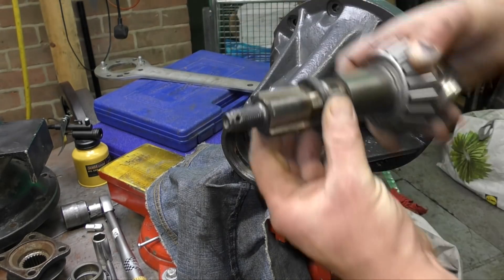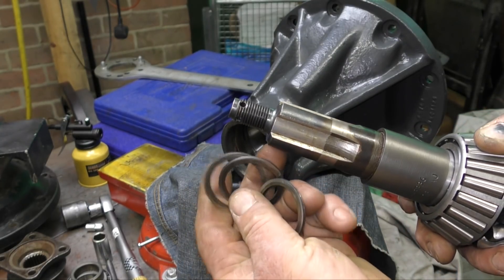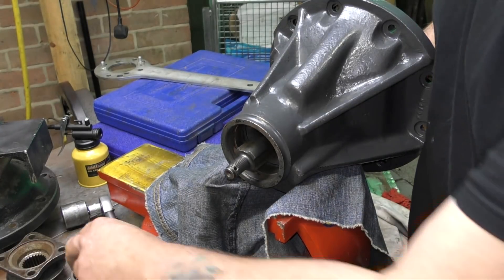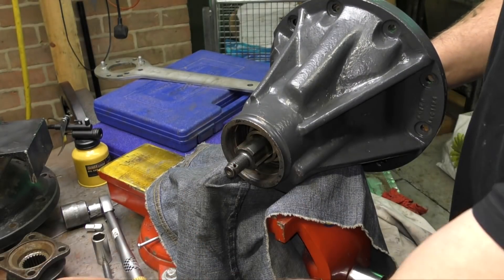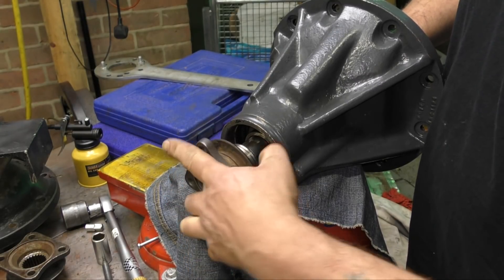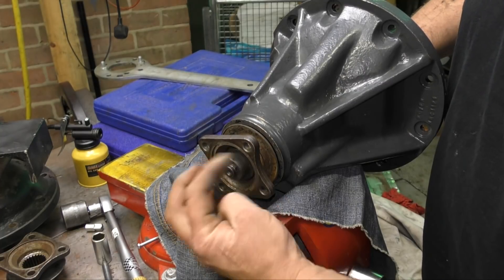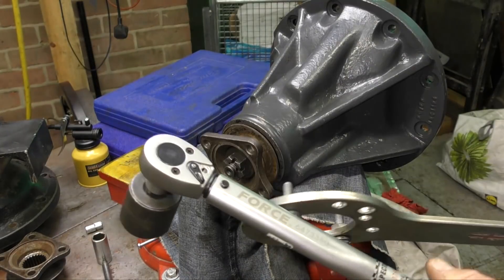The one that was extremely loose — I put three shims in. No good. So I'll put two in and then try it from there. I do have a discrepancy with the shims I've measured from these diffs and the ones that Land Rover recommends. There's a slight discrepancy. You can order the shims, and I expect you to order a few of them, not just one. There's no other way around this — unless somebody watching knows a way around it, it is a hit-and-miss affair until you get it right. It's trial and error.